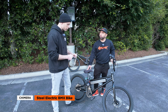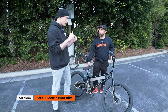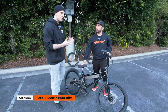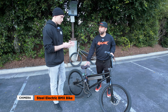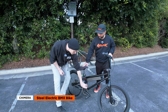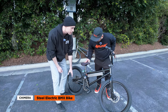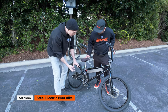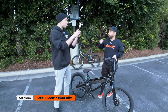With mid drives, when you put those on your bike you're relegated to whatever cranks come with that mid drive — you have to use their proprietary products. They're very difficult to work on and have a particular mechanical inefficiency. Most mid drives on the market have about a 30-to-1 reduction transmission. We're running at a little under 16-to-1, so it's a much smaller transmission, which allows a larger motor and pound for pound a much higher power system. Because we placed the motor in the center and the transmission up top, we left the bottom bracket alone, which means you can use regular off-the-shelf bicycle cranks. It's also modular — if you ever need to swap out your transmission, controller, or motor, you can do that without messing with anything else on the bike. That's much easier to work on than closed-box mid drives you have to completely dismantle.